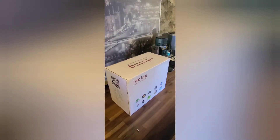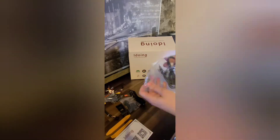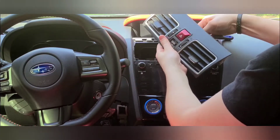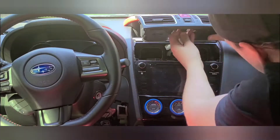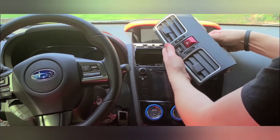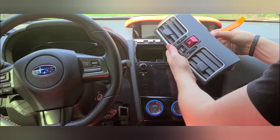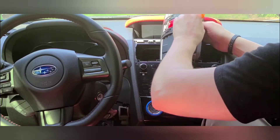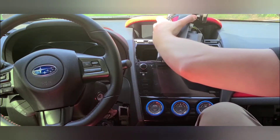The packaging is really nice — almost looks like an Apple product. They did a really good job securing the system; didn't have any dents whatsoever, no issues with parts, everything's wrapped. To remove the OEM radio, you're going to use the provided plastic prying tools and squeeze them in between the vents on the side, basically prying that open and working your way around. I actually used a couple to create a little separation — it makes it easier. Once you have that separation, you're pulling the tabs out, working from the top to the sides to the bottom, then pulling the entire unit straight toward you. It does take some force, so don't be afraid.